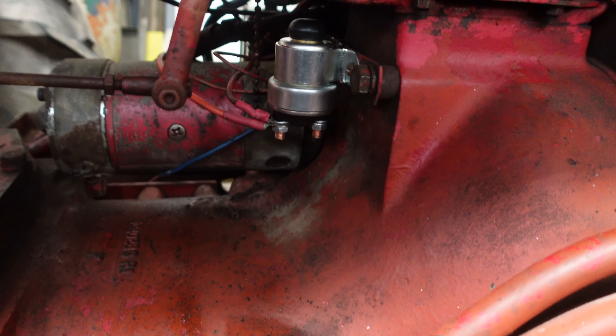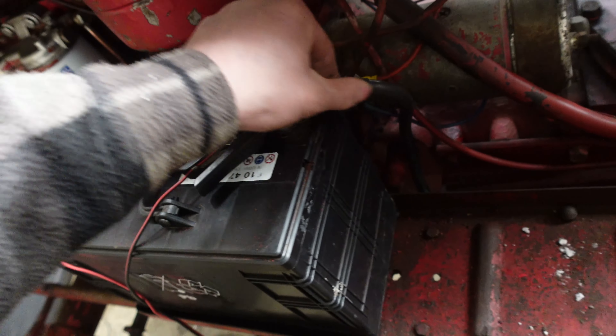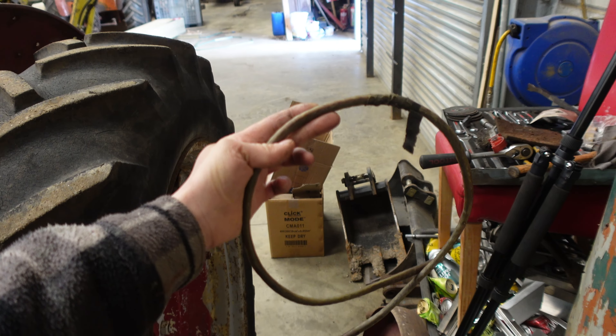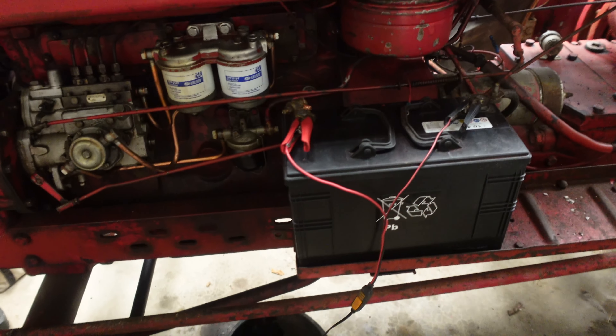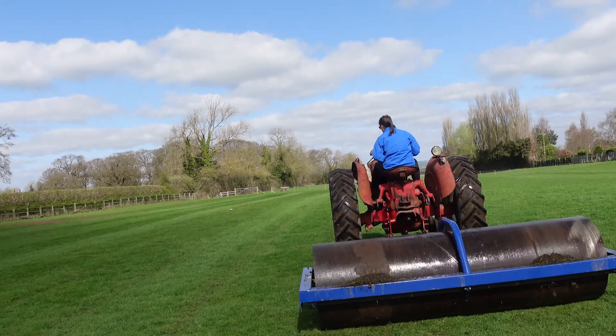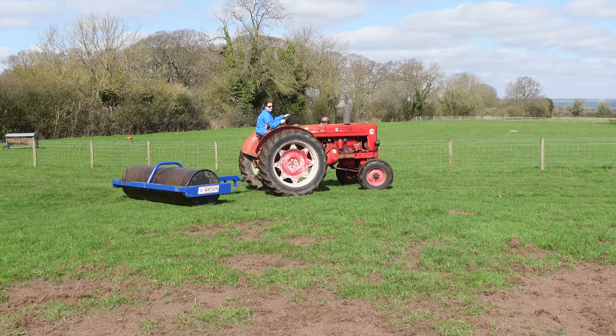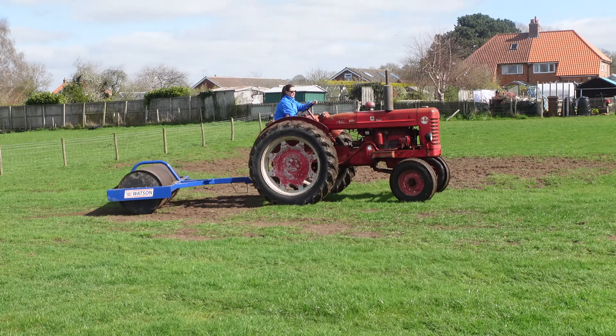When I got it back on, I had trouble getting it to start. So I did change the old solenoid valve. When I tested them, they had the same contact, so I put the two wires on the same one — but then it kept the starter motor engaged when you started it, which isn't what we wanted. So there's a new solenoid. That wire went up to the alternator. I've taken that off and given it a clean. Put a new battery lead on — that's the new battery lead there, though I haven't got new terminals yet. Starts way better now.